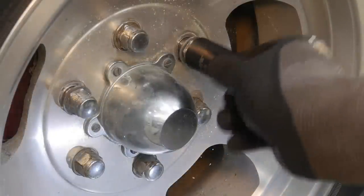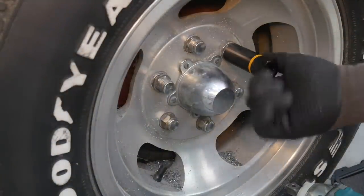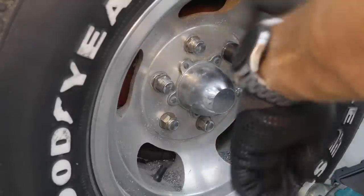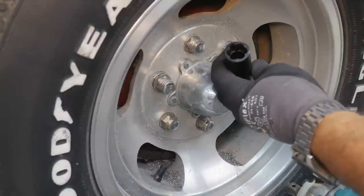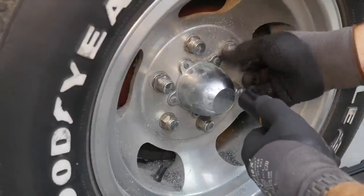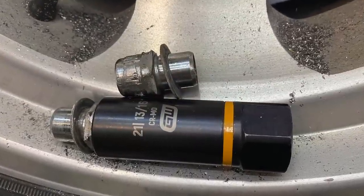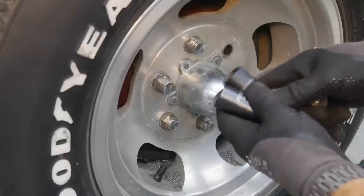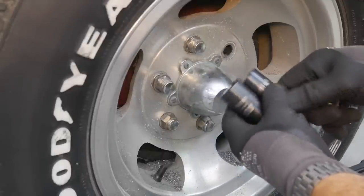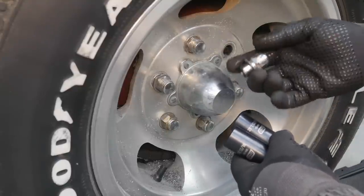And this is real testing here. I know there definitely could be worse situations with rustier fasteners and things like that, but I did want to show some real-world scenario, not just test bench stuff. Those straight flutes really bite into those lug nuts very well. And it's really cool that you have the opportunity not just one size for each size — we have the regular size and then the minus size for a little bit smaller. So that one was eaten down just a little bit more and that smaller size bit right in and got that lug nut off.